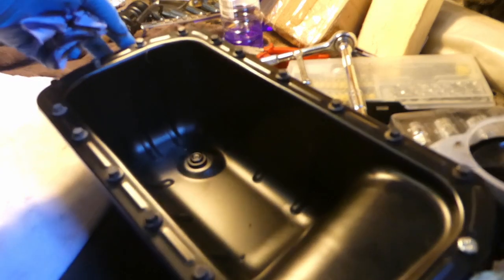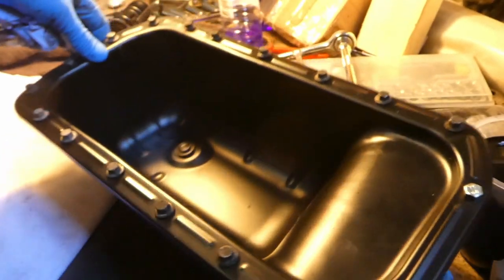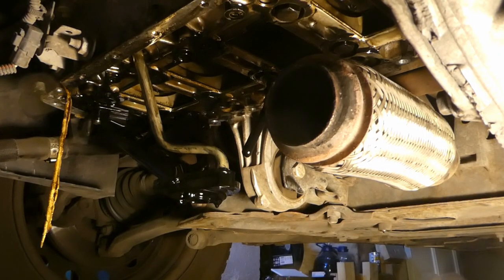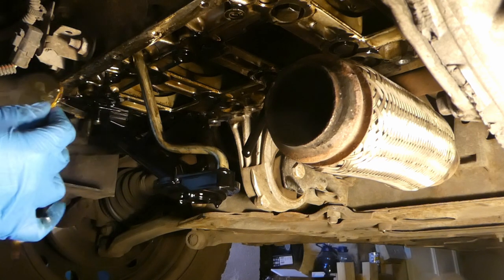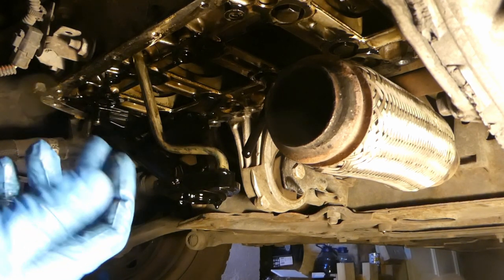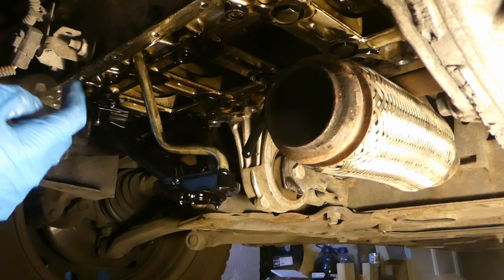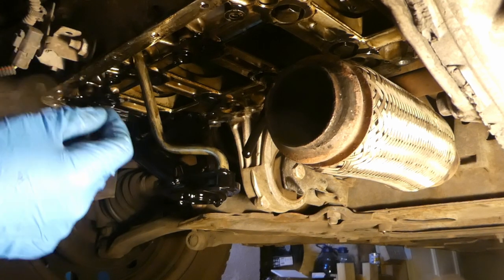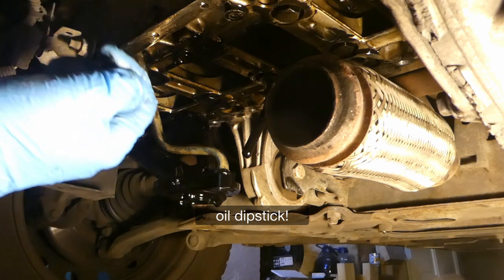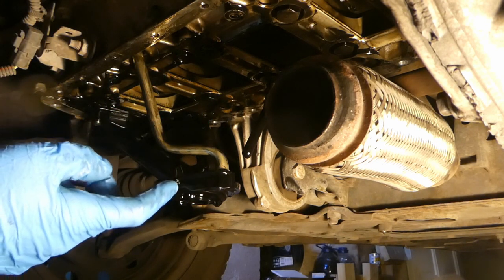This is what I did with the bolts - I put them all at their correct position and put a small nut on top just not to lose them. Here is how it looks underneath - that's from the sealant. I'll put something to capture the oil. This surface along the whole edges has to be clean. That's the pickup, and this is from the oil dipstick - this is really picking up the oil. And the pickup - there is a mesh underneath exactly here.